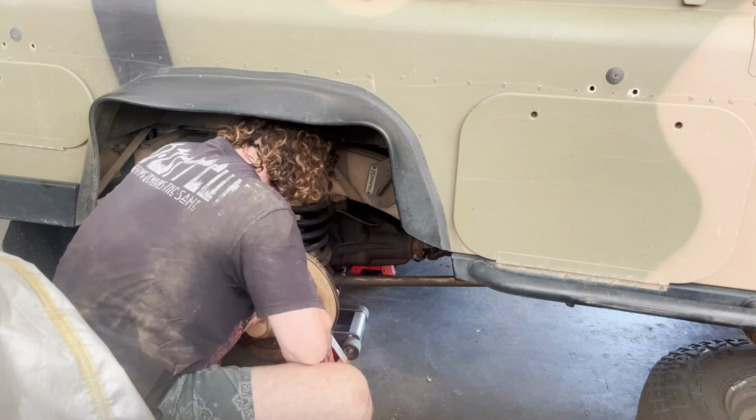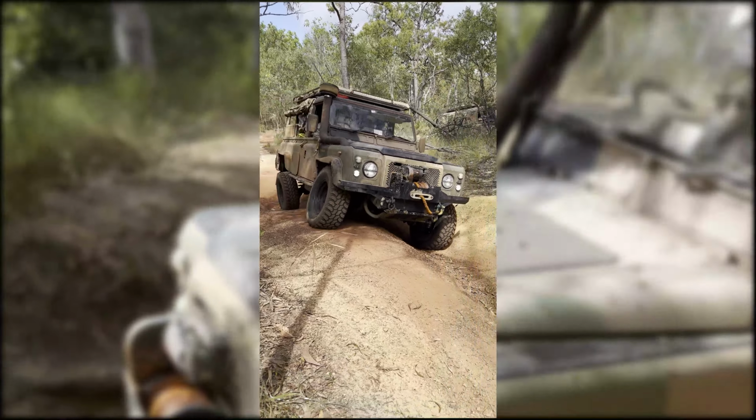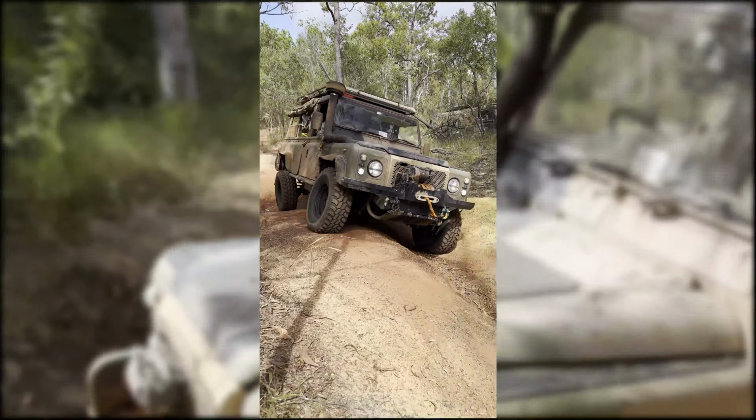These KYB shocks are designed for a 2-inch lifted 80 series Land Cruiser, but offer close to 80mm longer than standard Land Rover stroke length. They are actually 20mm shorter than both the Fox Remote Res and the Terra Firma shock. We will lose some down travel, but the Perentie had so much that bushes didn't last very long. These shocks are also very easy to find throughout Oz, and at $180 a piece are very affordable.